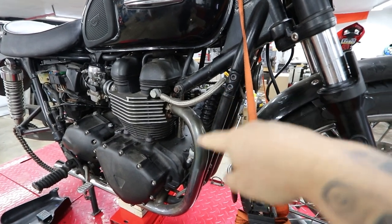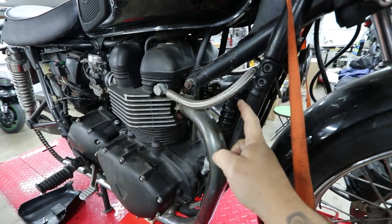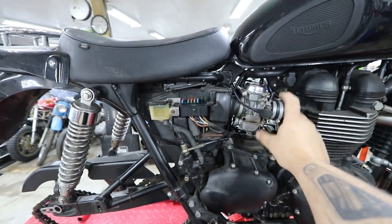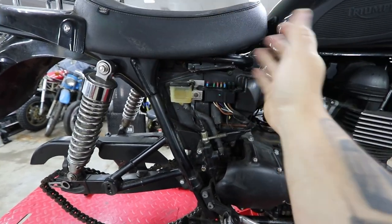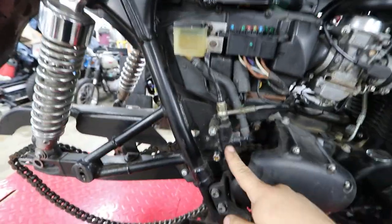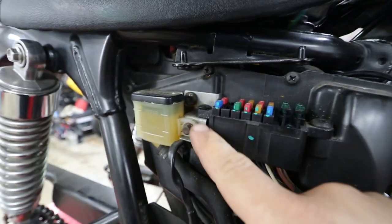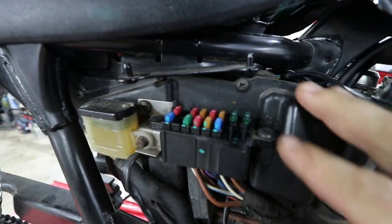The crash bar is off the front end and I put the motor mount bolt and frame bolts back in. I need to focus on removing stock parts. Onto these covers — the reason I want to take them off is I envisioned this build having the carburetors with pod filters, and a lot of this unnecessary plastic, covers, and air intake box I want to come out. On this side, fairly simple: you have the rear master cylinder and the reservoir up here. It looks like somebody actually did the fluids — it's fairly clean in there, which is a good sign.